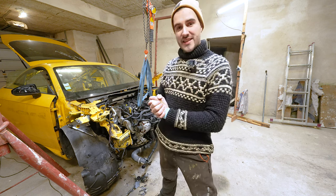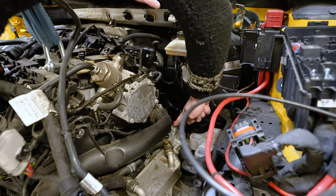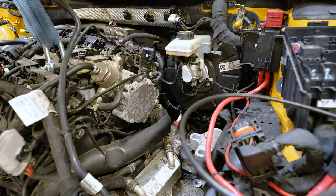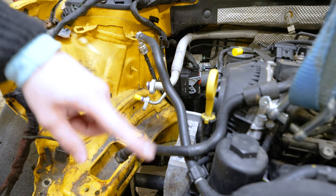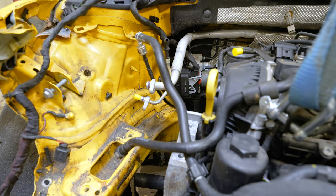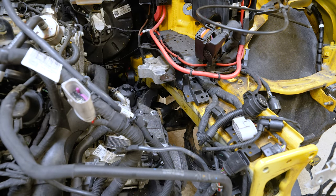This time around there are plenty of things we didn't think through all the way, so let me explain. For example, there's this gear linkage cable that goes from the gear shifter all the way to the gearbox that needs to be removed. There is also this fuel line - either fuel supply or fuel return - which has a connection I cannot get out. And over here is where the prop shafts are, supplying power from the gearbox to the front wheels - we need to remove those as well.